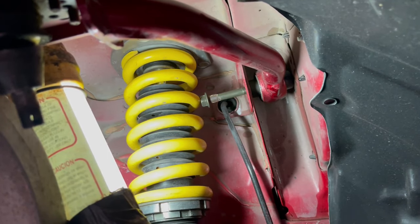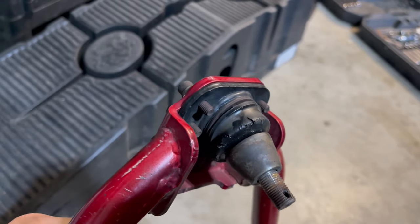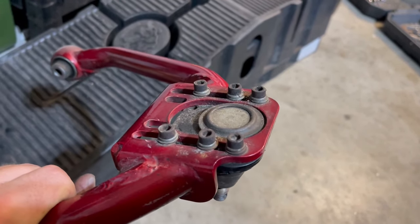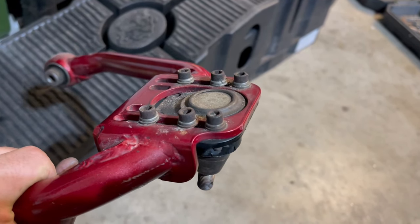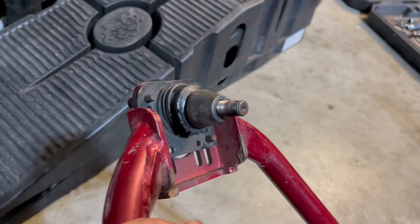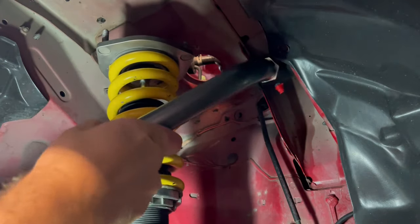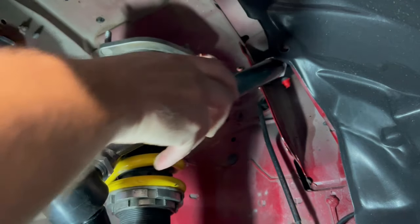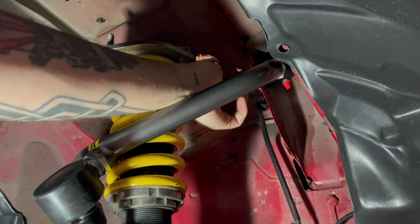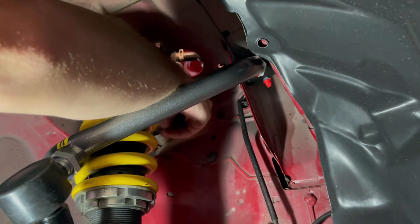And they're cheap — even if they're brand new, who knows when they might crack or break. So we're just going to get them replaced and make sure the rest of the time that I have this car it's good to go. And when — or if — we ever pass it on to a new owner, at least we'll feel good about it. Here's a look at the old one. It's in rough shape. I do like the concept — you can adjust alignment without taking the wheel off, which is convenient. But this being a not-so-great brand, if you're driving hard there's potential for alignment to get out of whack, which messes up handling and wears tires. It's better to go with a reputable brand that'll be a lot better in the corner.